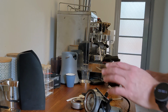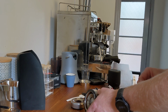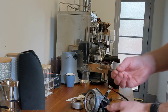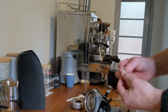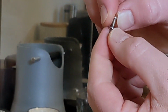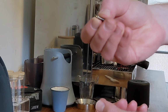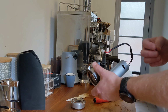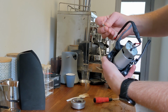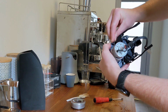Now if you've upgraded the top chamber yourself to the metal fork one from the original older plastic one, you will have had to replace the M3 bolts yourself. And many of the ones that you find at a local store will be this button head style. It's a fairly small head with equally small gripping washers. What you may find is that the head is a bit too small and rounded compared to the size of the hole in the plastic chassis.